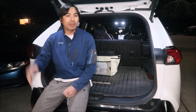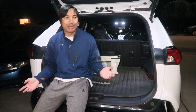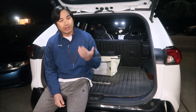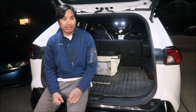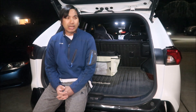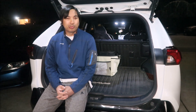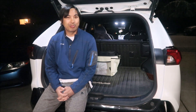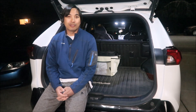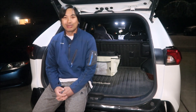So that's it — the inverter install is finally done. Unfortunately last time we had a bad breaker that didn't work well. The wire is 2-gauge — very capable. We pushed about 90 amps through it and it didn't even break a sweat — the wire didn't get hot at all. We never tripped the breaker. The breaker is 120 amps — the most we pushed through was close to 100 amps. That old breaker was popping at like 60 amps, which is about half of what the wire is rated for — that was a defective product.